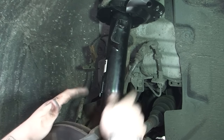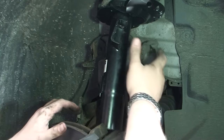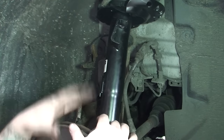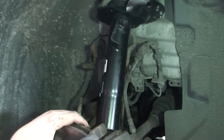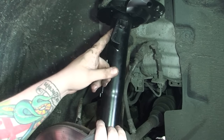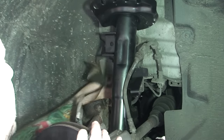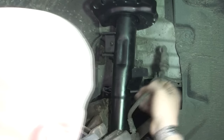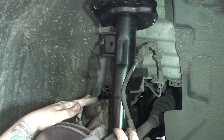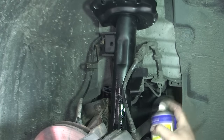What you have to worry about now is making sure you get all these pipes and wires on the right side. This is the ABS sensor and this is the brake line - get them right, because if you put this in with the pipes on wrong you're going to have to take it all back out. I've only lightly screwed in the top three bolts - they're not fully in yet, but in enough to hold the shock. You can turn it by hand very easily. Now it's in the right place for the drop link, ABS bracket, and brake lines.